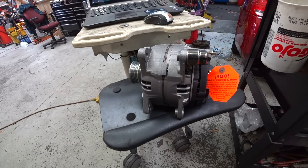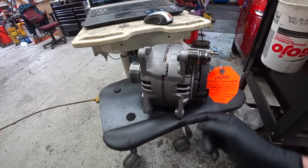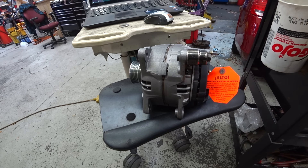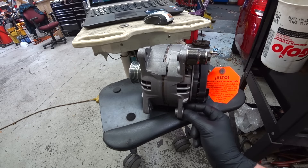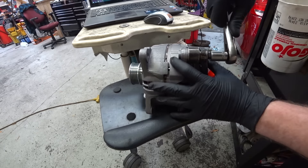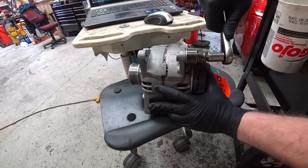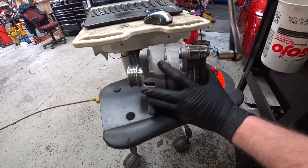So you've got a new or remanufactured alternator, and you have these little slide pins that you've got to pull back. Here's how you can do it. What I do is I get a bolt that fits into the slide — same bolt thread pitch and everything — and I take a socket, run the bolt through the socket. The socket is bigger than the actual outer piece.